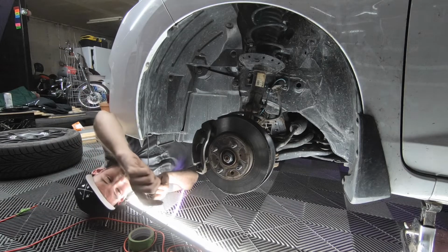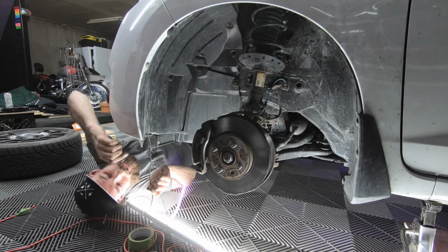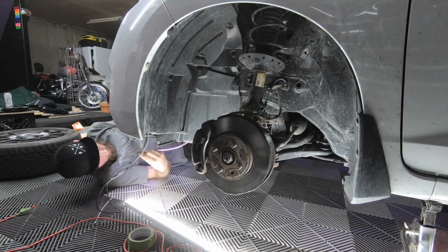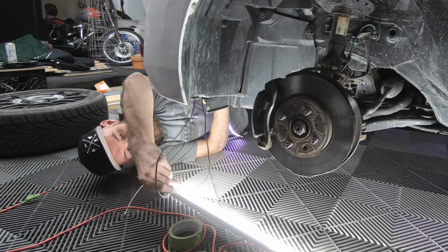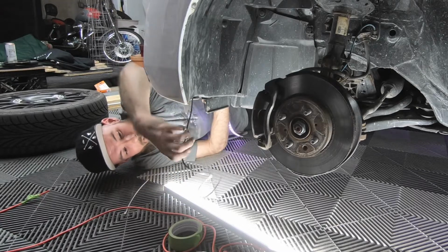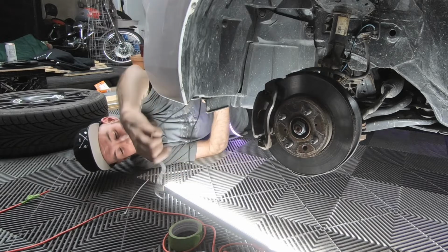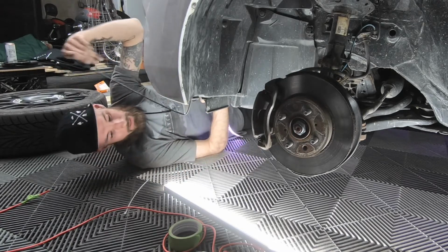So I just finished tightening the wire behind the trim and the wheel well. I'm still gonna leave the tire off to finish this up. This is the end of the LED strip I'm gonna put on the front bumper, figure out how much wire I have to work with, zip tie this up and hide it in the front bumper. That way if I have to detach my front bumper, I could always unclip this, and I got 2 or 3 feet to work with here.